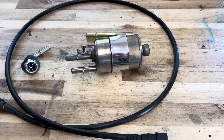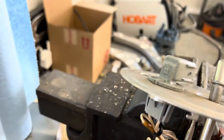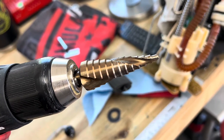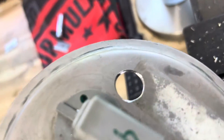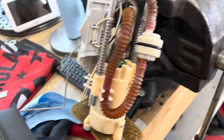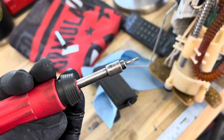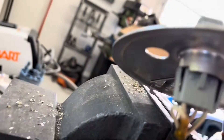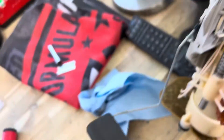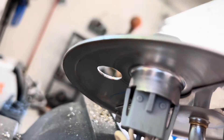Using the photo template, get the hole drilled — I go to just above nine-sixteenths — and then use the chamfers there before the step to deburr nicely on the top side. Make sure you use a deburring tool, which I have here, or sandpaper to take the chips and sharp edges off so you can install your bulkhead fitting, allowing the o-rings to sit in that 45-degree seat real nice.